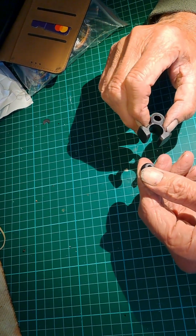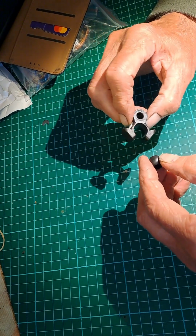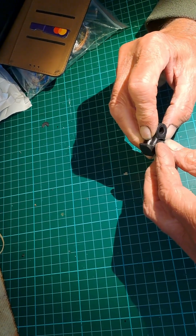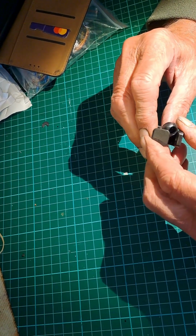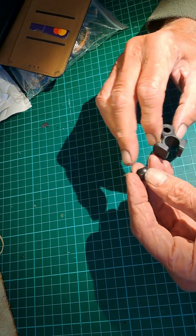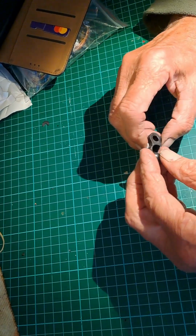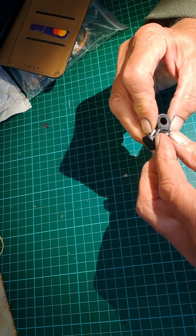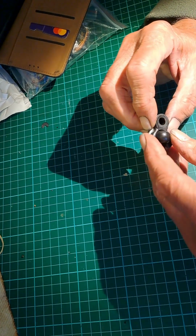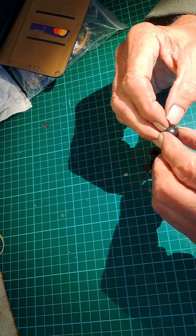This is the Brompton G-line ball and catch. So this is embedded into part of the handlebar stem, and that's attached to another bit. So when you close the bike up, they go together. Now, the socket head screw is countersunk into that part of the ball there and goes in there. So there's no room inside this catch, without modifying it, for the head to protrude any further from here.